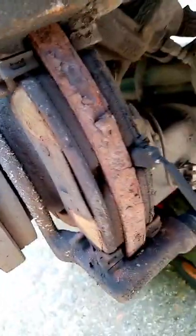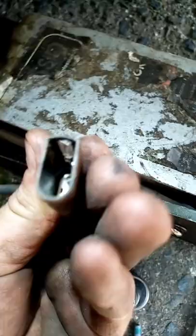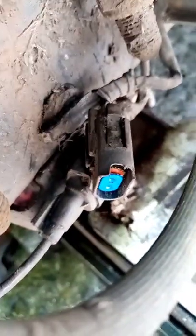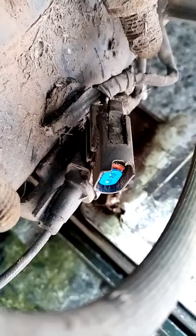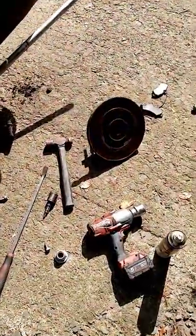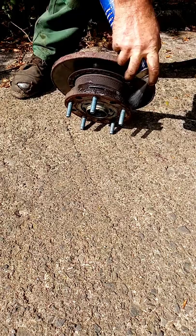This is the other side — the passenger side rear. You can see the passenger side has the wear sensor. This is the wear sensor plug, and that plugs into here. You've got to make sure when they're dirty, before you pull them apart — you see this little clasp here, it presses in. You've got to pick all the rubbish out of there, make sure it's clean, otherwise you'll end up breaking that plug. We see loads of people that just basically rip them apart and then end up having to join the wires together because they can't be bothered to spend a bit of time cleaning it out and doing the job properly. There's my trusty old steed up there. This is the passenger side stripped off there now.